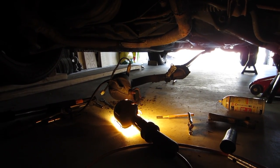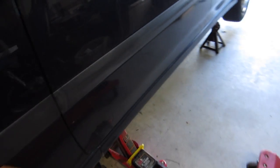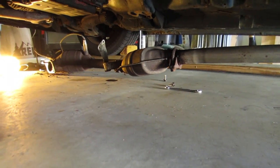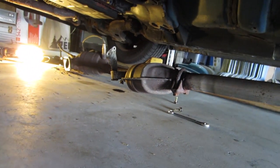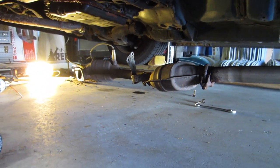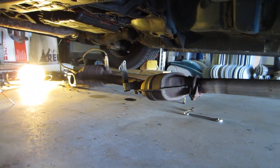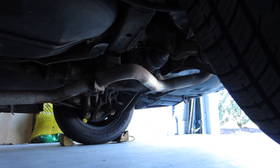I've got 20 minutes left, which is right where I want to be. Another project — coming back here, I decided just to remove — you can see that plate, those two bolts right behind the tire right now. That was hard to get that bottom bolt off, so I just took the top two off. That's what I did earlier when I changed the head gasket. But now just take the rubber boots off and we'll be done.